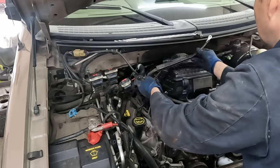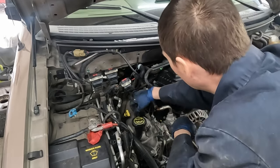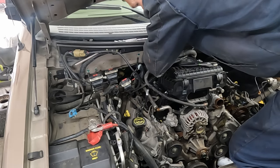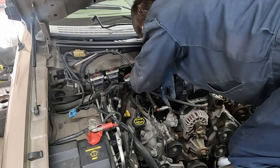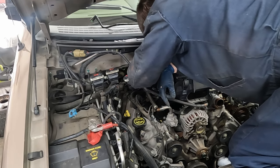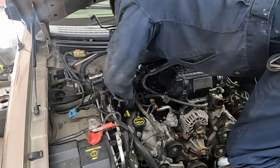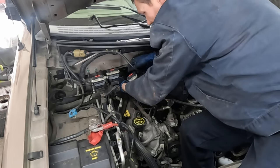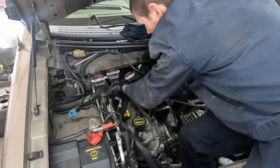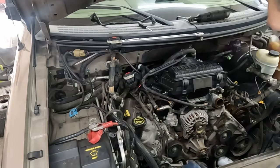Same thing here - just that little green tab that comes up and out. All our ignition coils: there's a red tab you want to pull up. The harness is connected to the top of the valve cover, pull that off. Undo this vacuum line so that's out of the way. Pull our ignition coils off. Now do the same thing - vacuum it out really well.